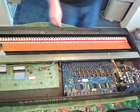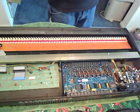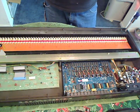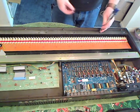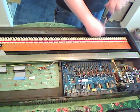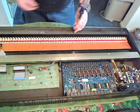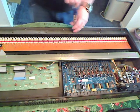Do not over-tighten these. Don't tighten them all the way up at first. Just get all of them in there so that when you start tightening them, you're not putting all the weight on one mount stud — you're going to be balancing the weight across all of them at once, to relieve some of the stress that could occur there.